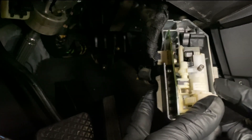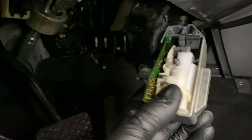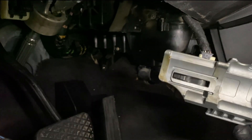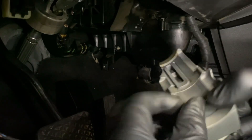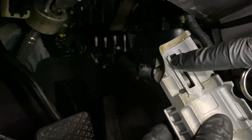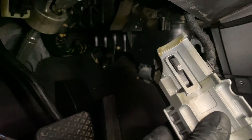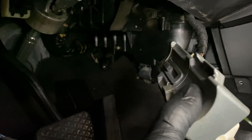I just thought I'd do a video and show how the system works because it's quite interesting. The key's off there now - I have to be careful because the casing's off. As you can see it's armed, so the plunger is inside there. Now that the key's out, that would then lock your steering column. It's only spring-loaded - it doesn't look like a conventional lock. You can push it in, but of course when it's bolted up you're not going to be able to push it at all.